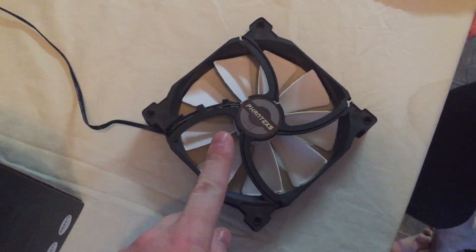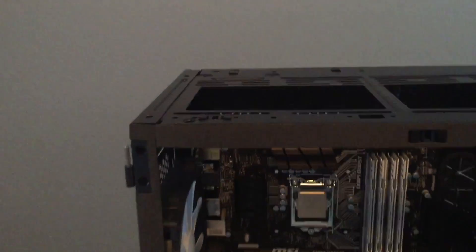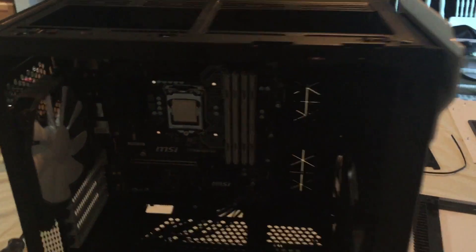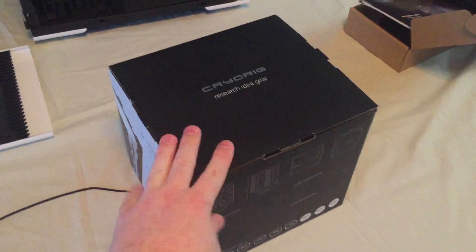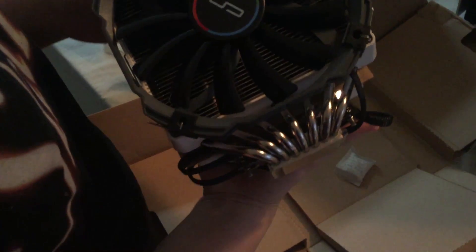These fans blow in the direction of the logo, so if you want air to come out of the case you're going to want to mount it pretty much exactly as it's oriented right now. As we neglected to put the CPU cooler on before mounting the motherboard — I'm sure some of you were yelling at your screens — this case conveniently has a cutout in the back, and some people prefer to do it this way. I'm fairly confident this cooler is going to fit. I looked it up online before I purchased it. It is just huge — it's actually a very pleasant unboxing experience just for a cooler. It's a snug fit.